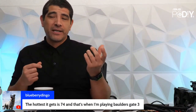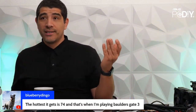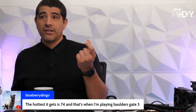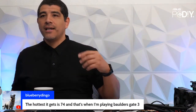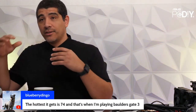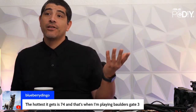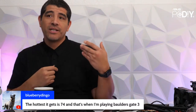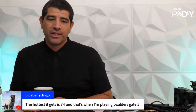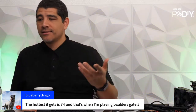After a year, I can go back and check it. And if all of a sudden after 2 years I notice, hey, originally when I was running these games I saw my temperature was 60 degrees, and now 2 years later I'm seeing 74 degrees. Even though that's still well under my thermal target that I have to be concerned with, I know that that's out of the norm. Maybe there's something with the thermal compound, maybe my fans aren't running at the right speed. There's some issue I would want to take a look into. And it could also be as simple as dust, debris, and dander getting inside the heatsink. So sometimes you might need to clean that out, right? Okay.